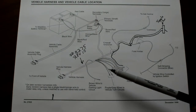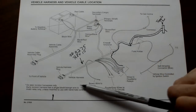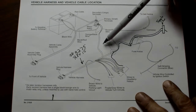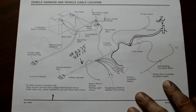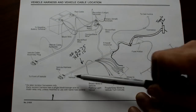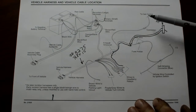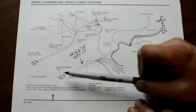And this video is about how I used just this wiring harness right here, and this one, of course. This is the wiring harness for the solenoid. There's a lot of videos out there, so I'm not even going to touch on that. But these are all the wires that are needed to operate the plow, and the lights are contained right within this one wiring harness right here. It's your little 6-pin connector that goes straight back down into your plow.